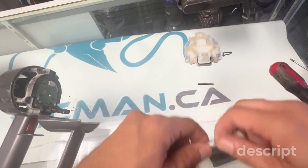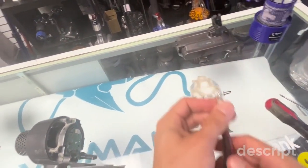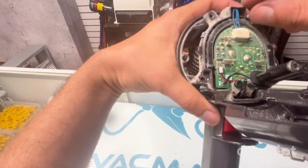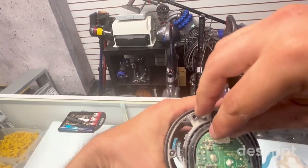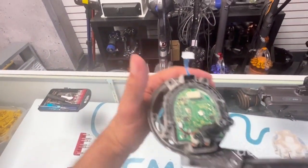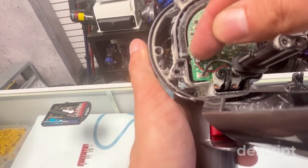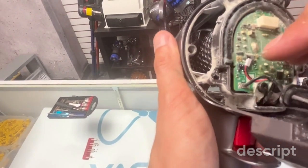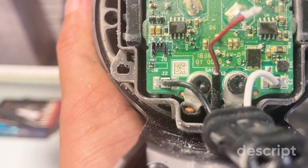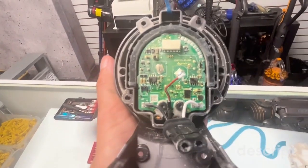We'll switch back our Torx. In the V10s and the V11s, it's pretty much a similar process. Here you have your speed terminals. Controls high, medium, low, or actually on this model, max. And then here, you want to be very careful with the tip of your nail. Gently, just clip it off. Okay, you want to be very gentle with it so you don't break any of these two little terminals over there. That's a common problem people make when they do this by themselves.